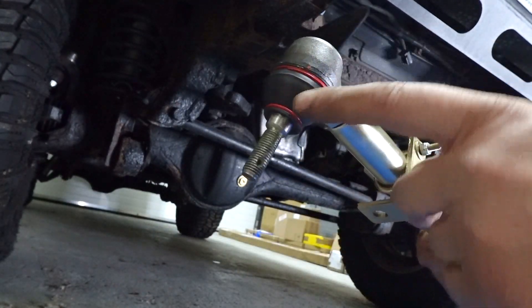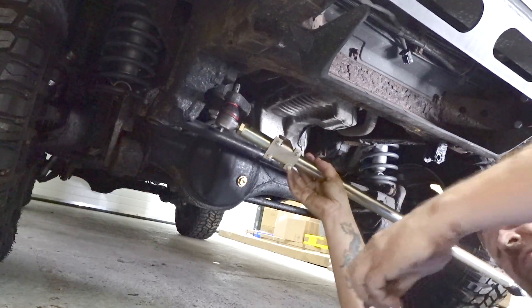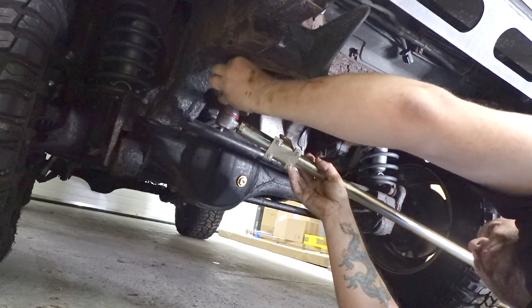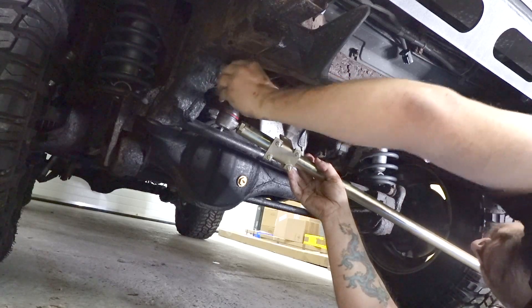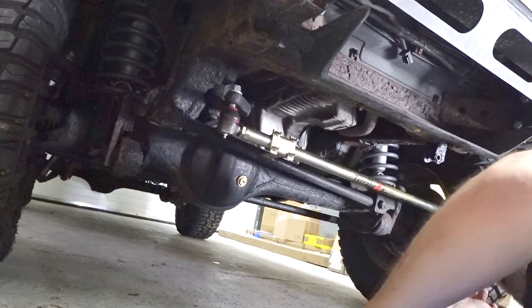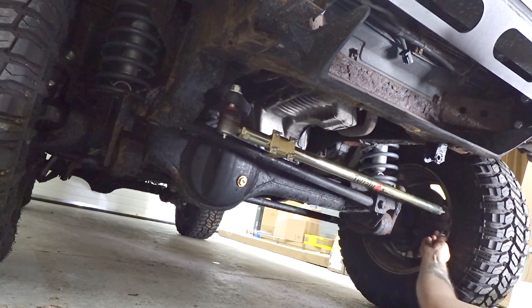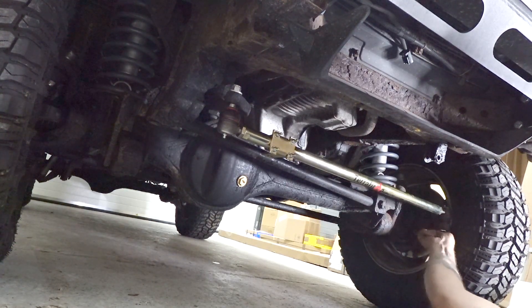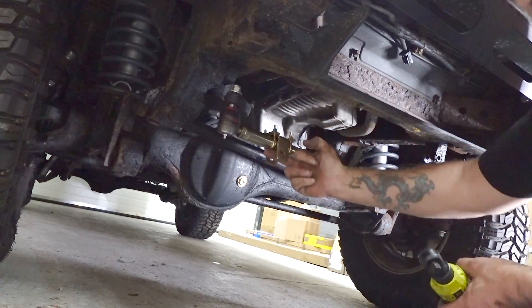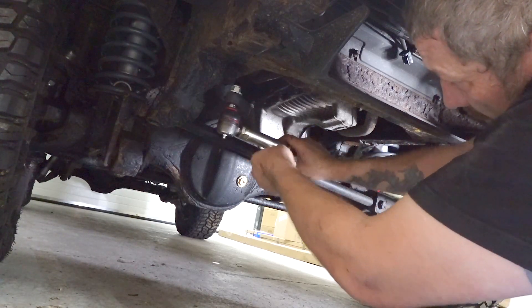Remove these plastic covers before you put it on - and that is the piece that goes into the location. We definitely don't want to be tightening anything up too early - just get it in position. It's slotted straight in, which is a good sign because it means we've got the length right. I haven't moved the wheels at all, so all the location points are the same. Now we can get our steering damper in place - but I've mounted this wrong, there's not enough room. It actually goes on the other way around so you've got more clearance.